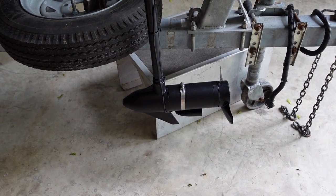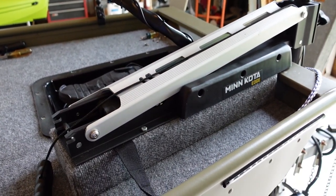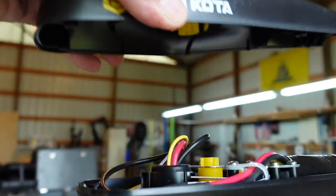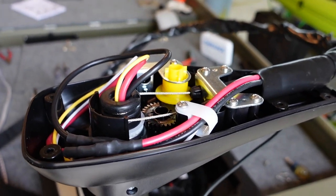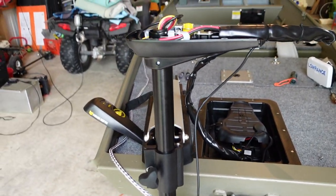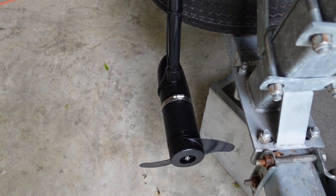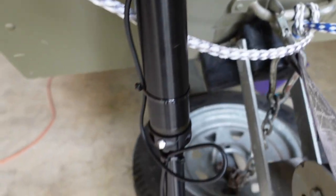Well, it's not hard to fix and even a moron can do it. The first thing is you have to remove the screws down here at the bottom — there's six of them. You're going to take the cover off of the head and it's going to expose all that complicated looking stuff, but it's really not going to be hard at all. What we're wanting to achieve is we want the motor pointed 180 degrees from where it is, with a neutral position on the foot control.